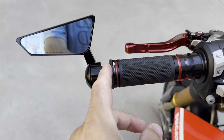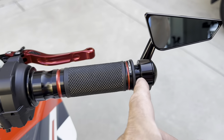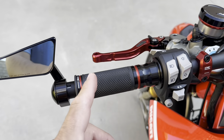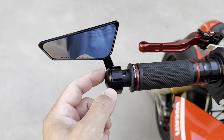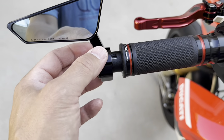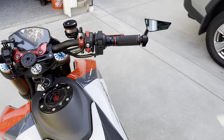What I want to do is close this gap — I don't like the gap in between. That's just the way these are right now because they're going inside the bar on both sides. I'm going to get some bar end caps, probably from CNC, just to complete the look. I'm going to remove this Rizoma bar end cap and mount the new ones here, so the cap will give a flush look on both sides. That'll eliminate that gap.